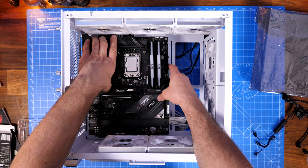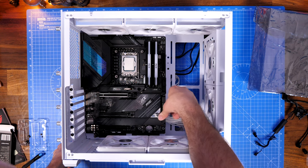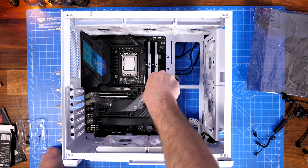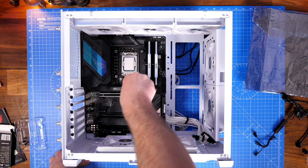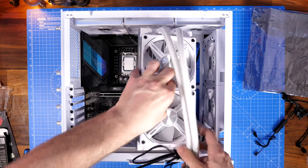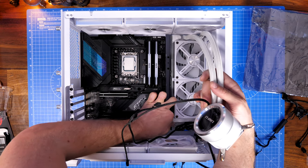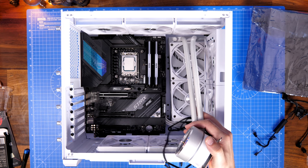The bottom can't be used for the radiator either. You could mount it on the front, but front intake fans are preferable for airflow. In this build I have two 120mm fans on the bottom and two on the front as intakes, exhausting hot air out the top, and also pulling cold air in through the radiator on the side panel. Now I'm installing the motherboard and positioning the radiator. In a previous build I found it worked better with the radiator at the back of the case.